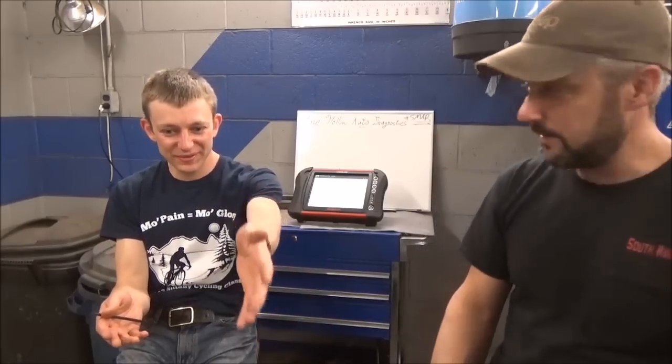So what do we have here? A 2006 engine with its own harness, trying to talk to the 2004 original computer. That had four wires different. Everything fits - all the connectors fit beautifully. Only four wires are missing - the only four wires they changed from 2006 to 2004 are your oxygen sensor grounds.